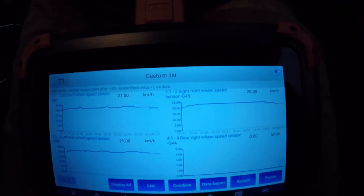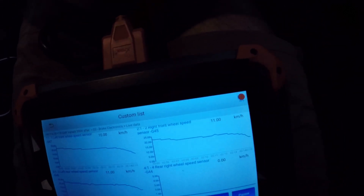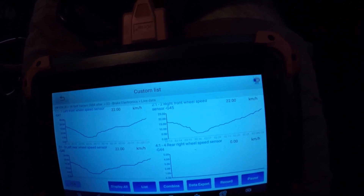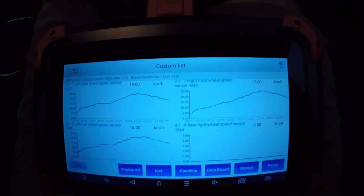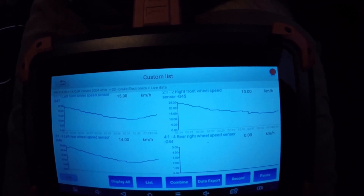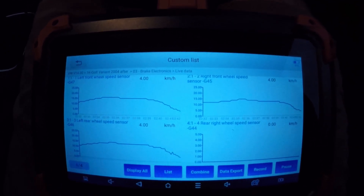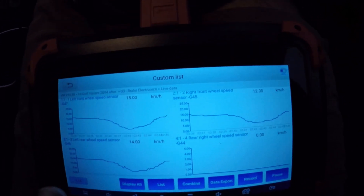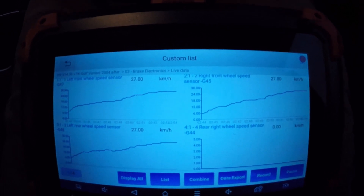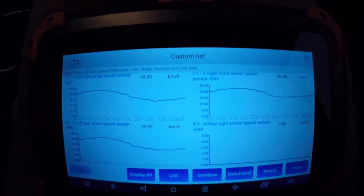What I'll probably do - it's getting late today and I need to unpack for my holiday - but tomorrow or at some point I will get the wheel off and check that the wheel speed sensor is plugged in. If it is, I've got an oscilloscope I could put onto the wiring and see if I can generate a signal just from the wheel speed sensor itself. I'm not too sure how they work, I need to do a bit of research. Or I might just transpose the left rear wheel speed sensor to the right and see if it fixes it - that might be a quick way to check it. I'll come back to this tomorrow and let you know how things are going.